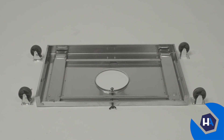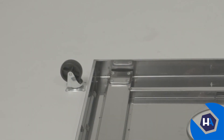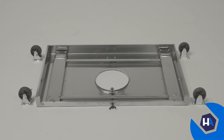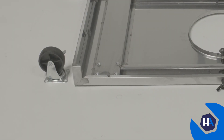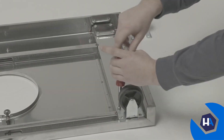We'll start by attaching your grill's four casters to the bottom panel. On this grill, you should have two stationary casters, one swivel caster, and one swivel caster with a brake. With the bottom panel flipped upside down, the two stationary casters should be positioned on the right side of the panel, while the swivel caster with a brake should be positioned on the bottom left corner. Secure each caster using four A-screws apiece.